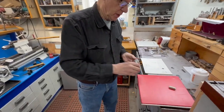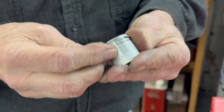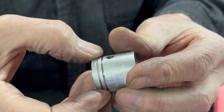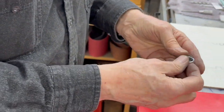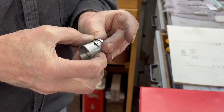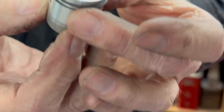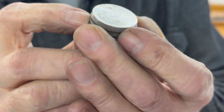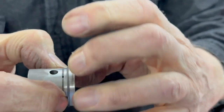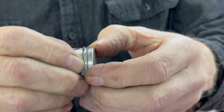Now I'm going to put the rings on the pistons. They've got a nice gap in them — see how that works out. Now you can see that will turn. Make sure they fit nice in the groove. This one goes on the bottom. And there they are. When you put those together in the cylinder, you want to leave three or four thousandths end gap — checking with a feeler gauge — and that's just about what I came out with.